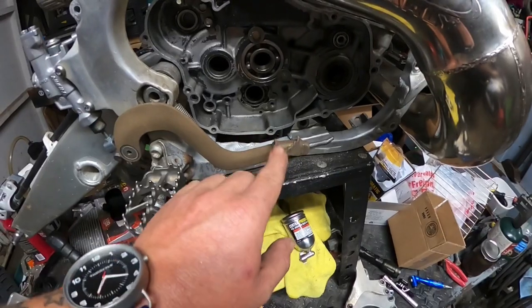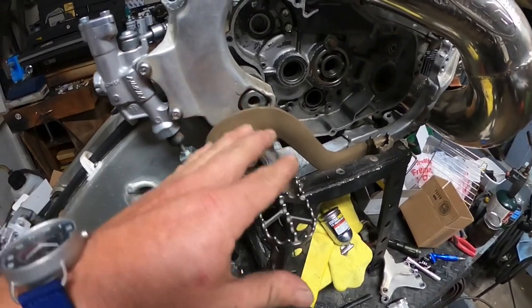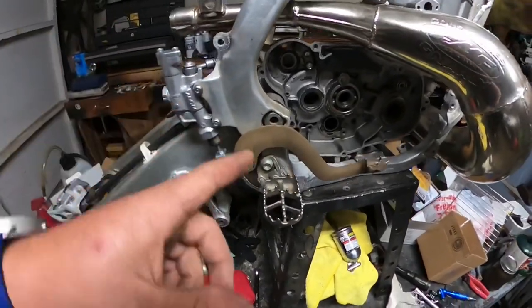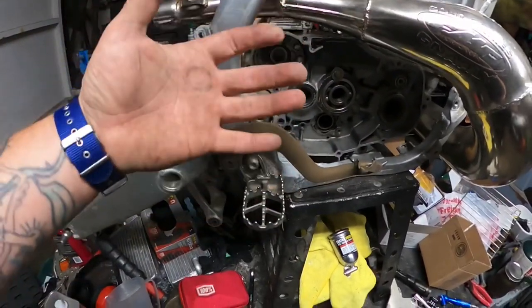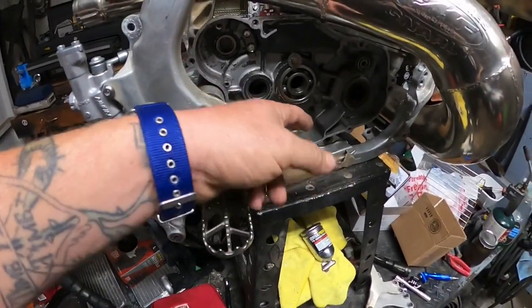I don't want it in the Cerakote, but I have to try. I have to practice, you know. So this was a really good practice run for me. So the question of, can you Cerakote inside a toaster oven? Absolutely, yes, you can. Caveat, as mentioned, if you cannot suspend the piece inside the toaster oven yourself, like from the roof of it or something like that, then you are going to get some marks from the grill.